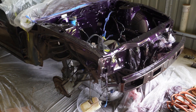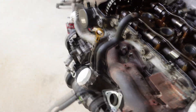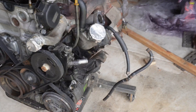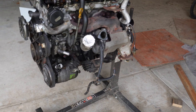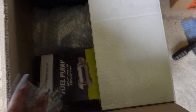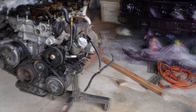It's going to look very different soon. I've already done quite a lot of it myself and I wish I had picked up the camera beforehand, but better late than never. Today I've got the rocker cover off — I'm going to give that a paint with my gun — and I'm going to try and get the manifold off as well. Once I get the manifold off I can put the new one on. I've gone for a six boost manifold, and I need to get a V-band welded onto that so I can put my wastegate on.